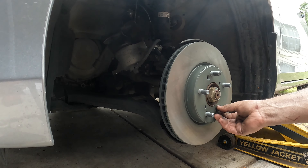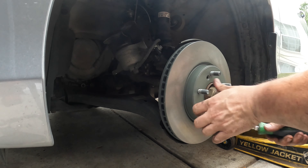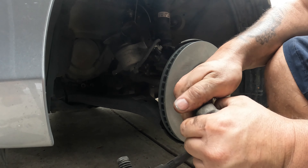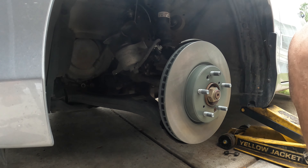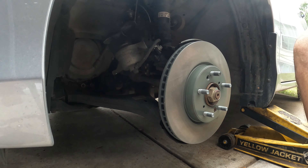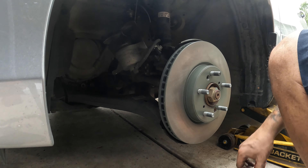I am going to reuse the screw — I know it is pretty rusted up, but it is better than nothing. Make sure that your sliders are nice and free. Also going to wipe down the brackets with some brake cleaner. We got new hardware that came with the pads. I'm going to go ahead and put some Loctite on the bolts — make sure you clean them off first and just put a little bit of Loctite on the threads.